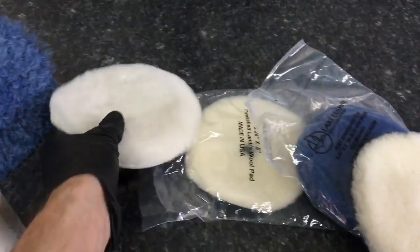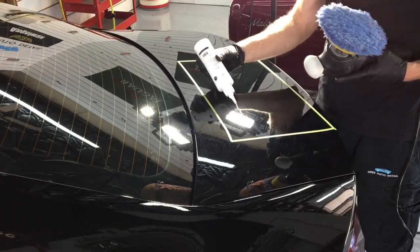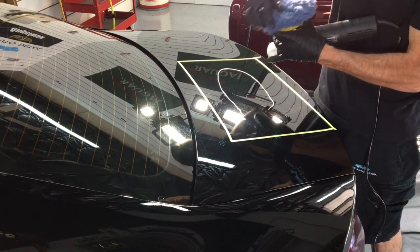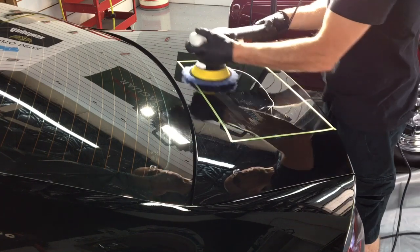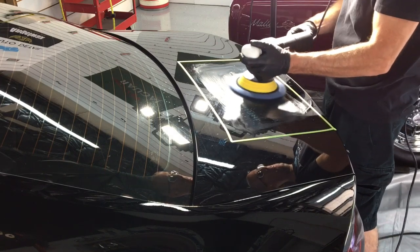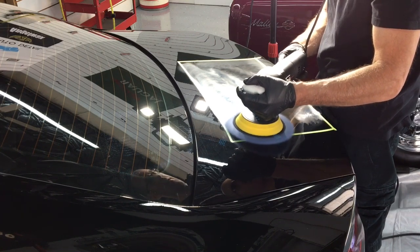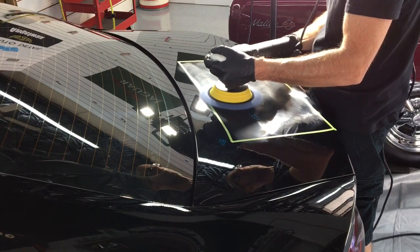We're going to team it up with some wool pads from Lake Country. What I have attached to the rotary is the hybrid blue wool pad from Lake Country. This would be great if it removes imperfections and gives us a decent turnaround for one trip around the car, because there's plenty of airflow that goes through the pad. It does generate some heat, but not as much as a microfiber or foam pad. We're going to see how many passes it takes — that's why we always want a test area to fine-tune the method, especially with the budget available.